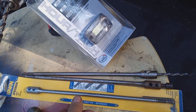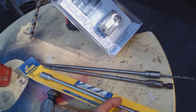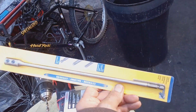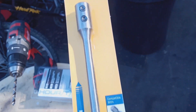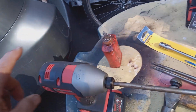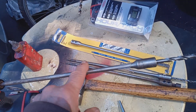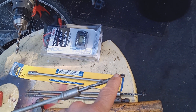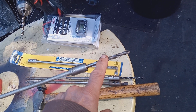You can get a drill extension if you want. I usually take the augers and impeller out — it's easier for me. I used to do it through the chute. You can take the chute off and use a 12-inch extension like this — this is an Irwin 12-inch speed bore, 304 millimeter — an extension you can put on an impact drill with the drill bit already on it. Or you can use a 12-inch drill bit. You want to use an HSS quarter-inch cobalt drill bit — it's for drilling hard surfaces and metal.